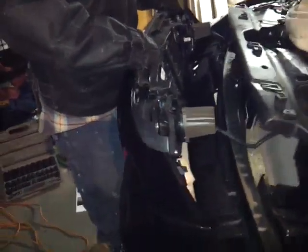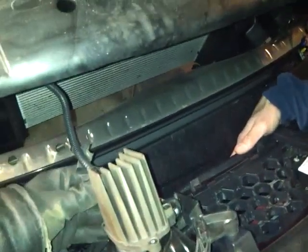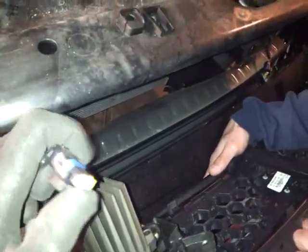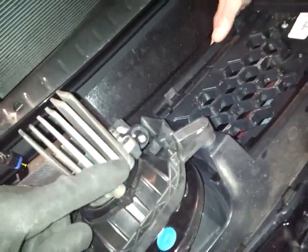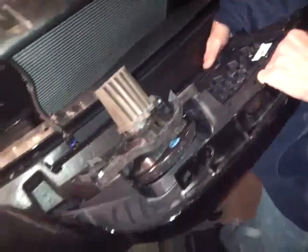Just take your time. Now take the headlights off. There's a clip down here — you pull down on this clip and pull it out. Or you could just take these out — these are Torx bits, I believe they're T15s. Take those out and you have more room in there to work. Now the whole bumper comes right off.